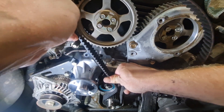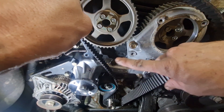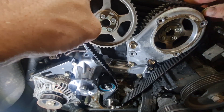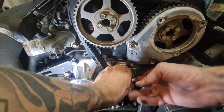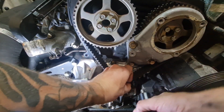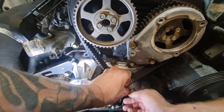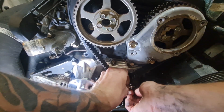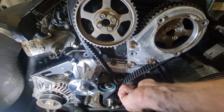Put the belt on as tight as you can on the left-hand side, keep strain on it, put it over to the right, keep strain there, have your idler ready — and you should be able to very gently wind it in. You've got to be careful not to cross-thread anything. Look how easy that is.